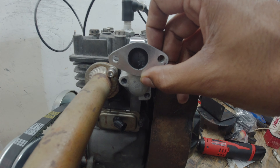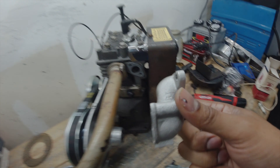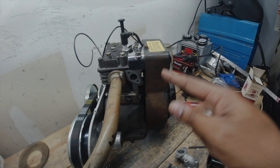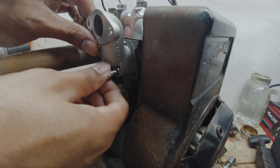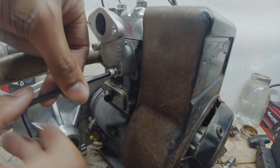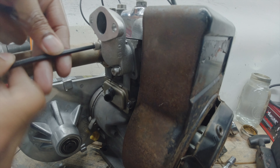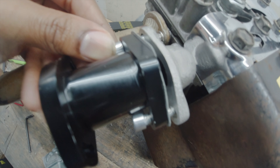The manifold is almost directly where it needs to be. I think these are like two-inch bolts, and that should work because one side of the intake manifold is thicker. Enough talking, let's get it installed. The install is going to be like any other — make sure your gasket is on there and then just install it, not a whole lot to it. I believe these came off a Tecumseh flat head as well, so Tecumseh and Briggs used very similar motors because this literally mounts up just like it's factory. I'm gonna drill something out and I'll be right back.